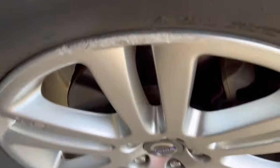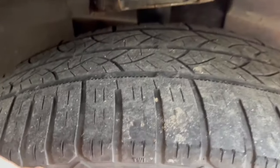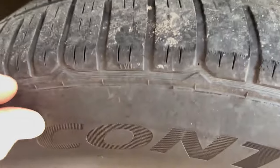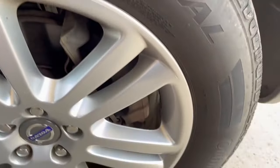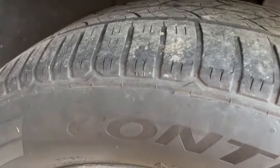However, the tires on my car are well past due. If you look at these and get in close to the top of the tire, you can see they still have some tread but are well past due. The wear markers on these tires are at the same level as the top of the tread. These are Continental TrueContact Tour — the exact same tire as the new ones — so we're comparing apples to apples.